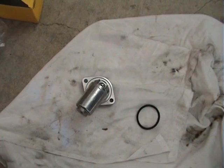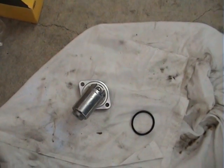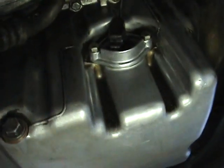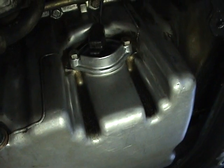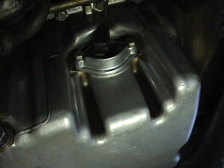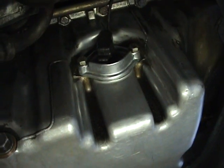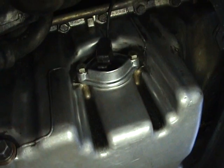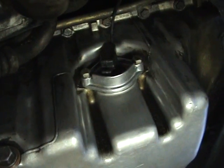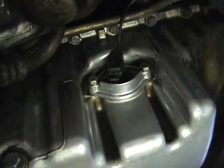There was oil coming out, and it's still running into a tray now, so I might as well save what I can and put this one on in its place. Well, there's a new one on. I've got a feeling that this is not really my problem. But I won't know until I take the car for a run, and preferably a long run, and see if we use any oil or not. The next show might be all about changing valve stem rubbers, or worse, the whole head job. But the car has not lost any power or anything like that, so we shall see.